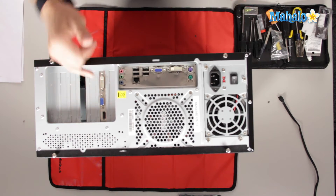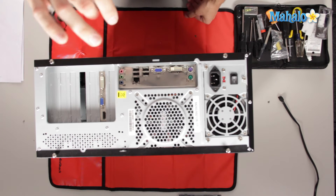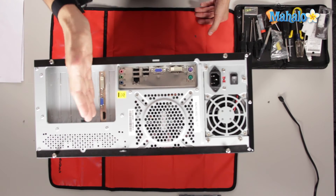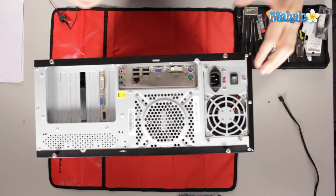Let's break down what we've done so far. We've connected our video via any of these for our video, unless you have two monitors. For our audio, we have microphone and also our speakers. The default for speakers — if you can't hear anything, just swap the port. For our USB, these really don't matter for a peripheral like a mouse, a keyboard — anything of that nature will work in a USB port. Ethernet, only one spot it can go. For the video, if you have it down here, go for that; if it's only up here, plug it in there. Keyboard and mouse: green for mouse, purple for keyboard. And then our power — you'll have two power cords because the same power cord will fit inside your monitor and also inside your computer case. The same cord will fit both ways, but one difference is you might have a longer length on your monitor than your computer case. Make sure you have your power ready to go and you are ready to turn on your computer in its new location.